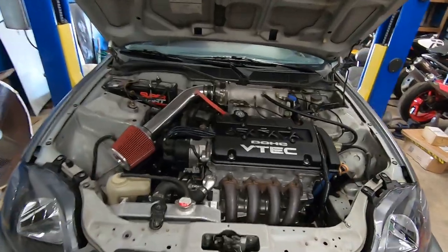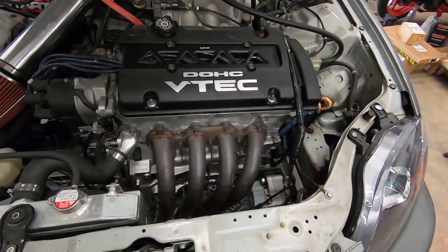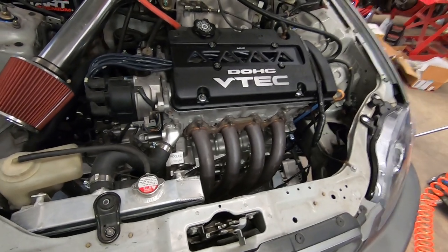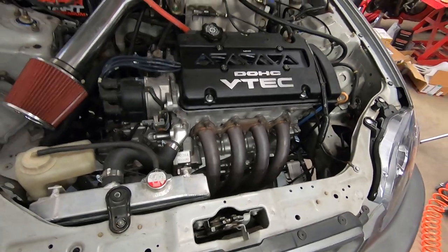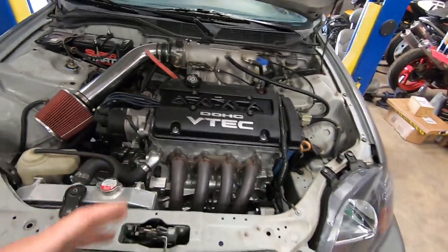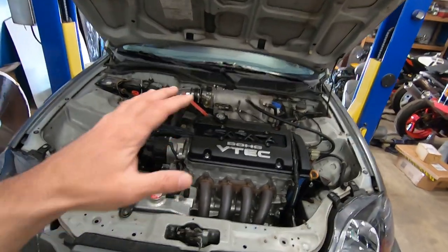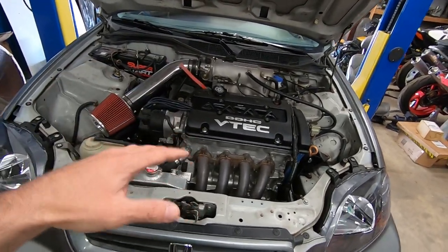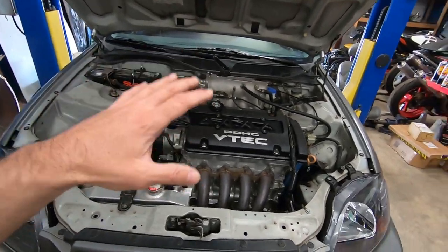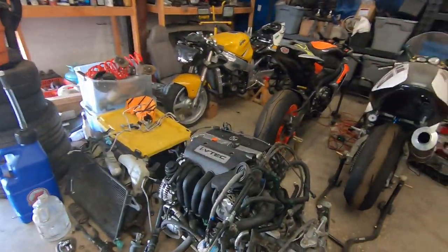Now that you guys know the details of the budget big brake setup, I'm going to go over the story of why I am K-swapping the Civic. I have a nice H22 setup in the car, but I did not do my research when I built this engine — I bored it out too much. These cylinders are fiber reinforced and you're not really supposed to be boring out H22 blocks. I bought some bigger pistons and bored it over too much, and shortly thereafter about 500 miles it developed a lot of smoking and I dropped compression in cylinders three and four. So for that reason I was looking for another engine, and I came across a $500 K-swap.